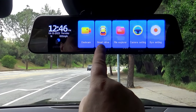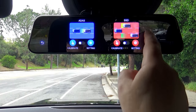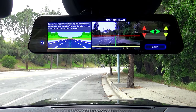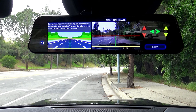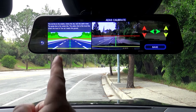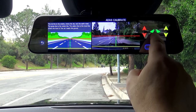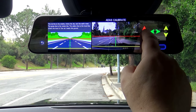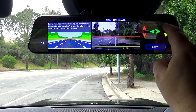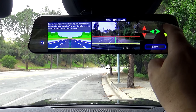Now let's go back and enter the smart drive assistance. Here you have advanced driver assist and blind spot detection. But before you can use it, you need to calibrate it. Park your car on the street with clearly marked road lanes — the image on the left explains it all. The red line has to center on the horizon at the top of the end of the road. The green dotted line has to be positioned in the middle of your lane. You must adjust it on the live view using the green and red arrows. The yellow line has to be positioned on top of the hood. Use the yellow arrows to raise it. Once everything looks perfect, remember to click the save button — otherwise you lose everything.